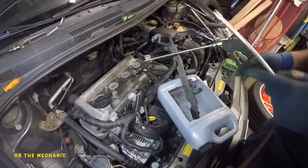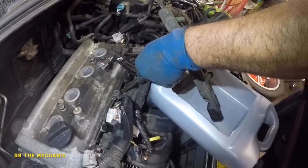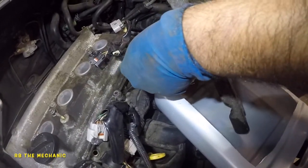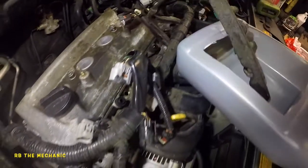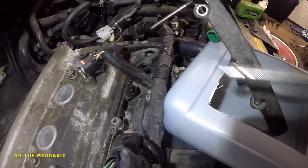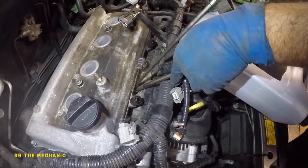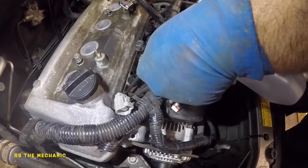Okay, so what I'm gonna do is cover up the hole right there. First thing first, I'm gonna clean up the dirt around where the seal is gonna sit. There you go. Remember, we did the engine, we cleaned before, so ours is pretty clean. So use a vacuum, that's what we originally did. I want to do that to that hole, and I'm using this socket to cover the internal hole so nothing goes inside. And I'm gonna do a little bit more rinse right there. Same thing here. All four holes gotta be clean, and one more over here. And that's it.